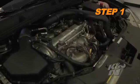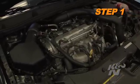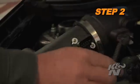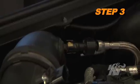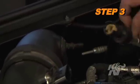To begin the installation, turn off the vehicle's ignition and disconnect the negative battery cable. Disconnect the mass air sensor electrical connection. Release the locking tab and then disconnect the crankcase vent hose from the stock intake tube.